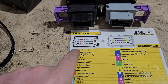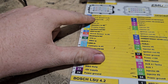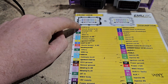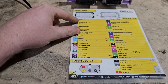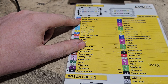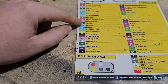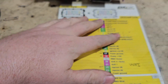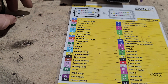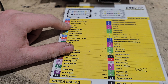Starting on the black connector with number one: this is the EGT — exhaust gas temp. There should be two of these on most setups. We've got knock sensor number one and knock sensor number two — the knock sensors on the front and back of the 2JZ block. You can also use a single knock sensor for engines like the 4G63. The analog inputs are for pressure sensors, gauges — you can run AEM gauge analog wires to the ECU. You've got coolant temp, which is a necessary one — this reads coolant temp for the ECU, not your dash.